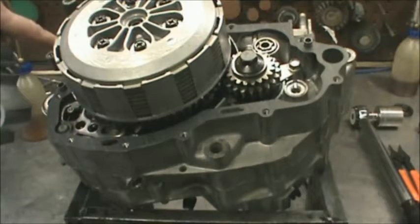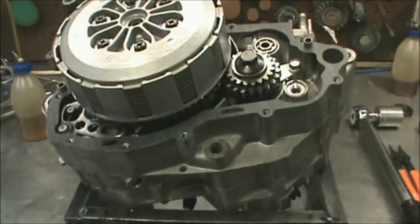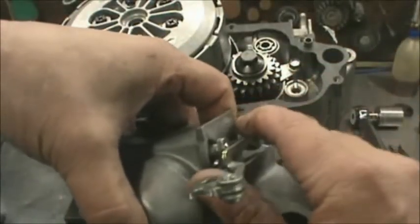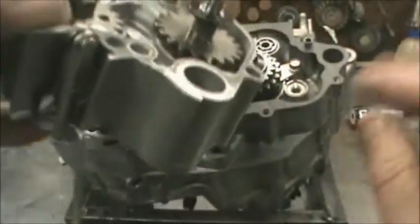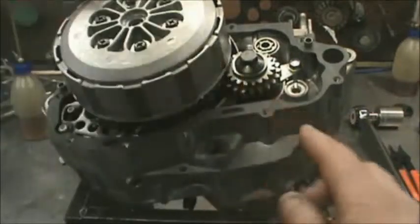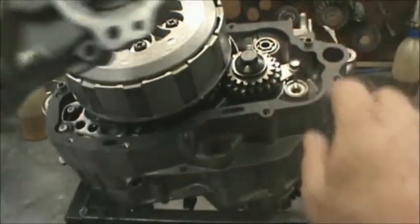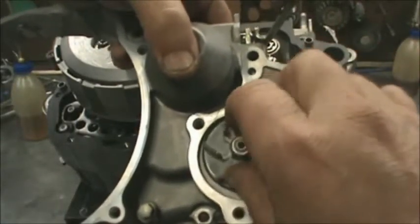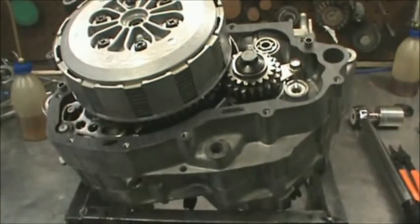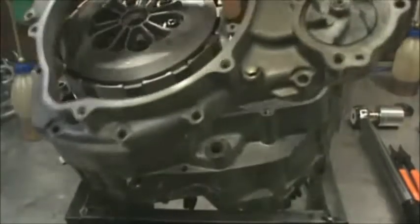Make sure the spring for the kickstart hasn't changed — make sure that's going to be all right when you put it in. You've got your pins in, your gasket in. Hold this rod down when you're pushing the cover on, and that will retain the governor mechanism. Make sure that happens. The water pump's not going to go anywhere. The gear right here is going to have to mesh with this one, so as you're bringing this cover down, you may have to turn this just a little bit. You may also have to turn the crankshaft. Just don't force anything — this cover will go right on over all of this.